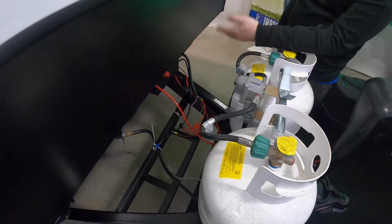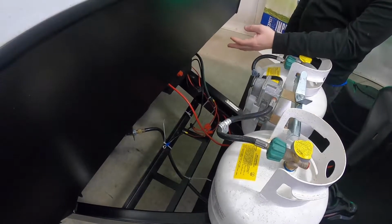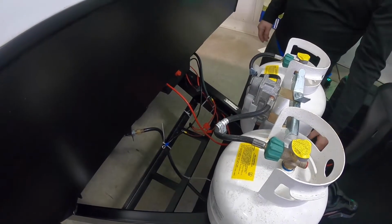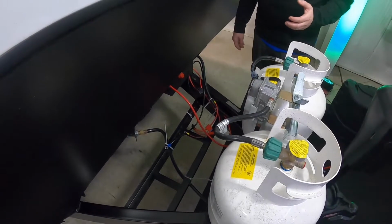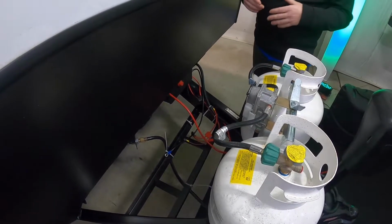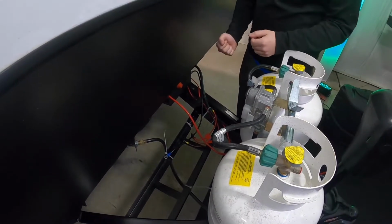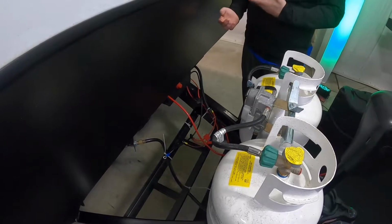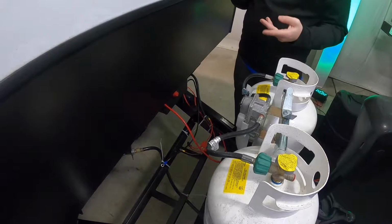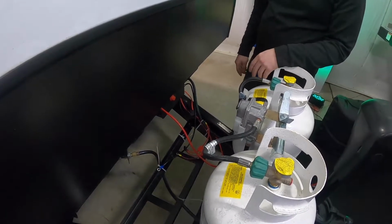You will have a 12-volt battery back here. It's a Marine deep cycle battery. Now that battery will charge anytime you're plugged into the shore power on the trailer or to the 7-way cable. The biggest thing with that is those batteries are not maintenance free. You need to check the water levels in them every 6 months or so. They've got little caps on the top; pop them off, and make sure that it's filled with distilled water. Low water can cause overheating, and it can cause undercharging. It won't charge at all, so that's something you want to check periodically.